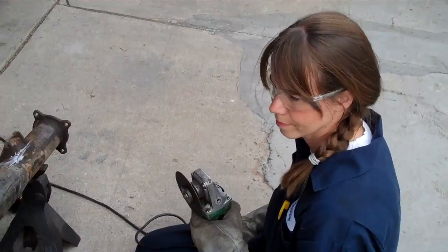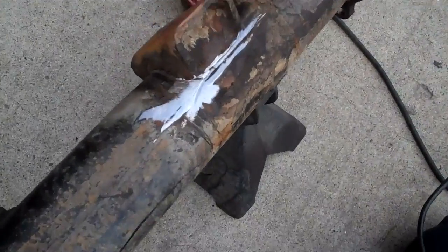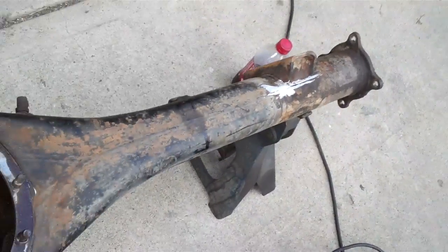So the next thing to do in rebuilding a Toyota axle is get a grinder and cut a bunch of holes in it — just kidding. No, we're getting it prepped because there's cracks. There's a crack right here all the way across the front, which is common especially if you have a bad ring and pinion because it will bang and jerk on it. And this one just got ripped. It's got cracks coming clear out to the side. It should really be thrown away but we're going to salvage it — it's going to take a lot of wire and a lot of gas but it will be stronger than it was before. You can fill up to a quarter inch easy, half inch as possible, and it's ripped all the way back here.